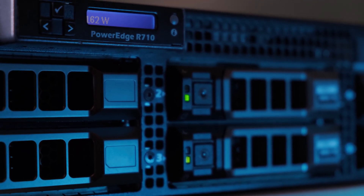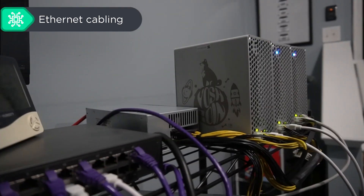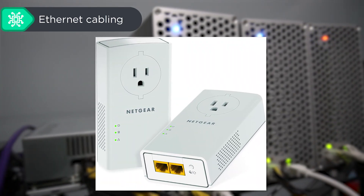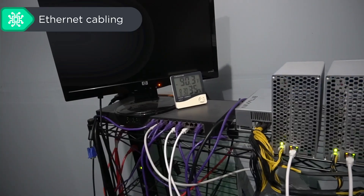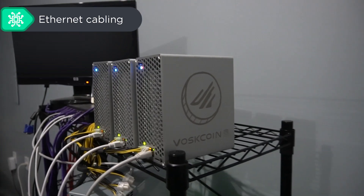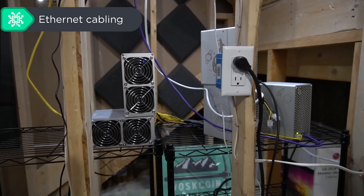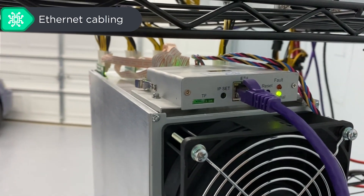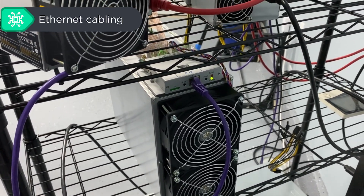There are a lot of ways to get internet to your device. You can plug it directly into your router, run a 100-foot ethernet cord, or use a powerline adapter — which is what I run in my house. You plug one in next to your router and one anywhere else, and it carries your internet through your power lines. If you need more ethernet connections, just get an ethernet switch — readily available on Amazon for under $20. Most ASIC miners do not operate on Wi-Fi, and honestly you get way better reliability off an ethernet cable.